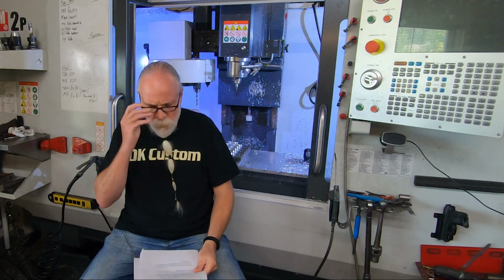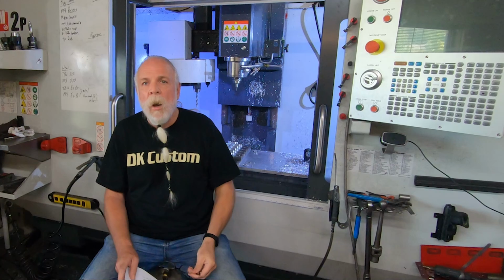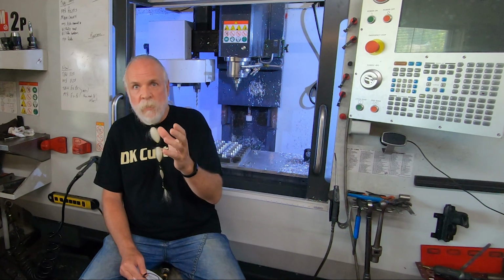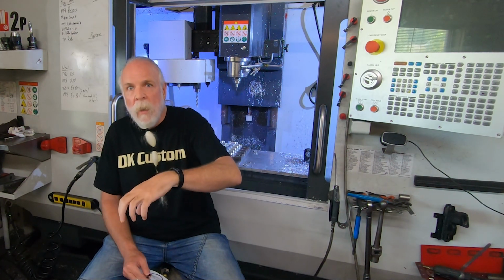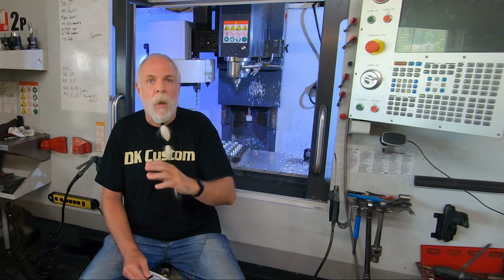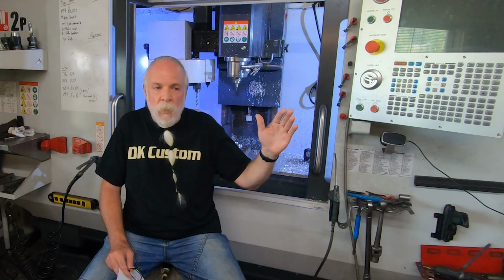And then the third is that the exhaust should be hot, but not be made any hotter by restrictions or reversion. So the hotter the exhaust is, the better, because it's going to help pull that exhaust out of there to make room for more cold air and fuel to come into the combustion chamber. So you want the exhaust to be hot, but not hot because it's all backed up from an overly baffled exhaust and that's heating it up. You just want it to be hot.